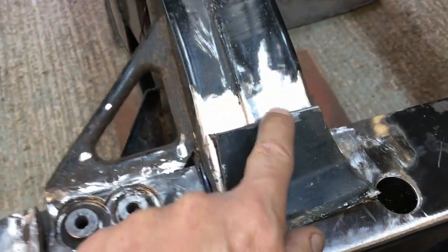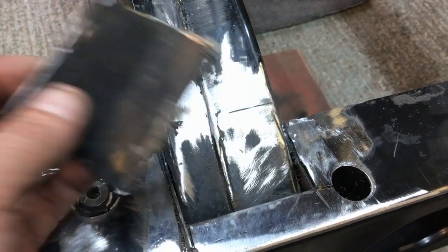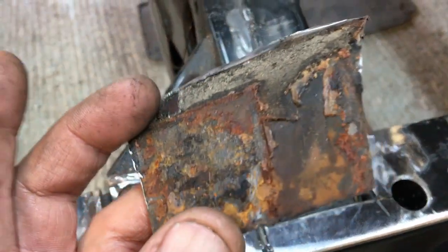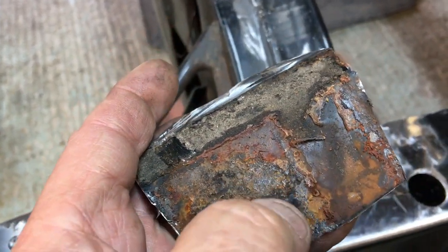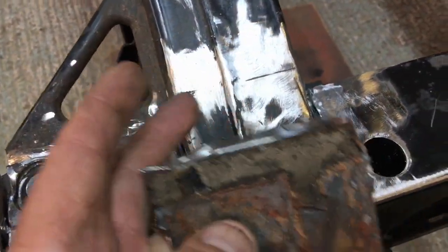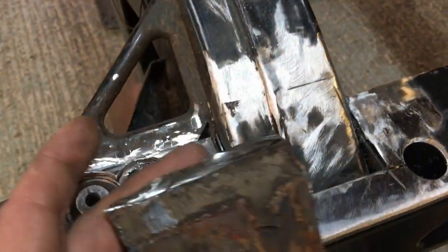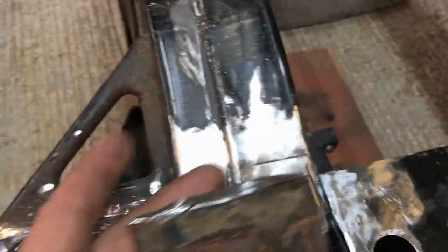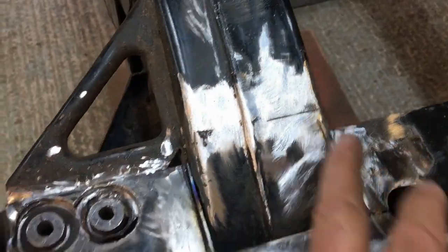You can see this stiffener plate which is welded all the way around here onto the chassis on the rear crossmember. I removed that and found underneath it was rusty. You can see the wax oil under my thumb but it didn't manage to creep in underneath all these chassis rails. So what I intend to do now is thin the wax oil with turpentine — which I've done before, it works — flood it into these areas, plug all the holes, let it really soak in and it will capillary into the tiny little gaps and save that rusty area. Then I'll remake these plates and weld them back on.